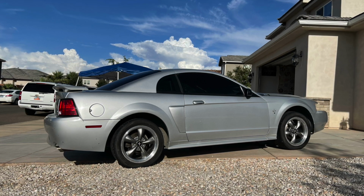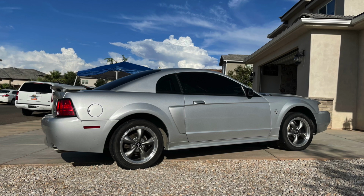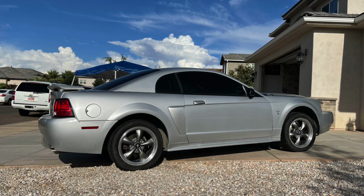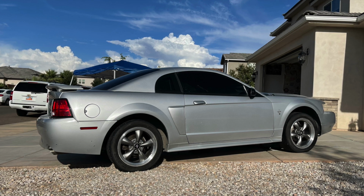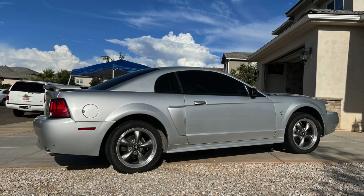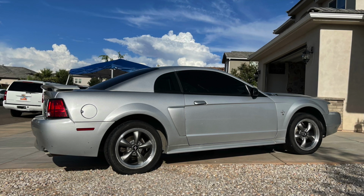So I had looked it up, and the yoke was the only difference according to what I found, and I actually found a 5-speed that was laying on the ground there underneath a 5-speed GT at the wrecking yard, and so I compared them, but the 5-speed one was missing the yoke on the front. So obviously somebody probably went in there for that, but when I laid the drive shafts down next to each other, they were the same length up to the yokes. So anyway, that's the reason I had that. I'm glad I had that one because I could just throw it on and be done.